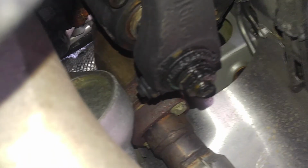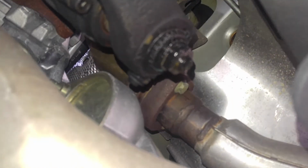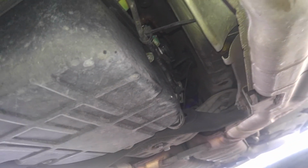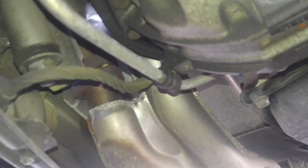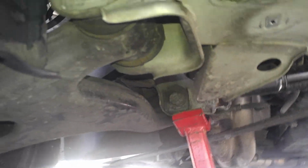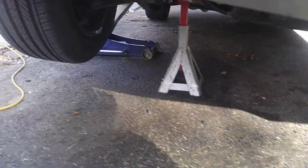The steering box seeps a little bit. They always seep like that. Nothing to really worry about, because most of them leak. It's not critical at all. Also, when the car is driven, it should be better, because seals get moisturized, they get hot, they get cold, so it needs to be driven. Underneath it's very nice despite all these little things, but that's not critical, nothing to really worry about.